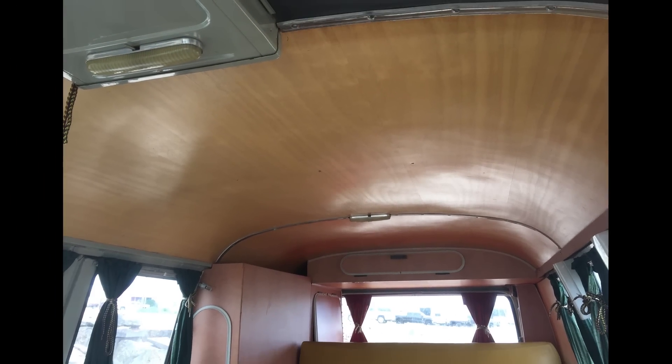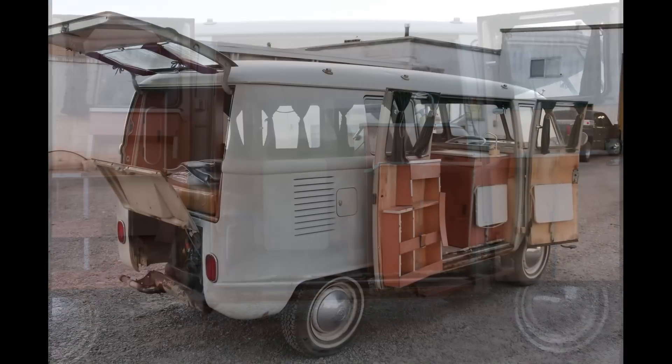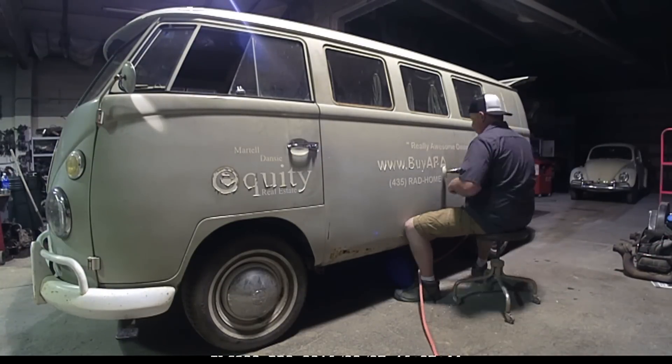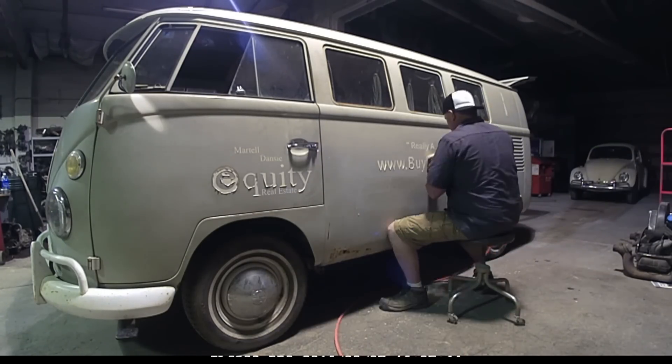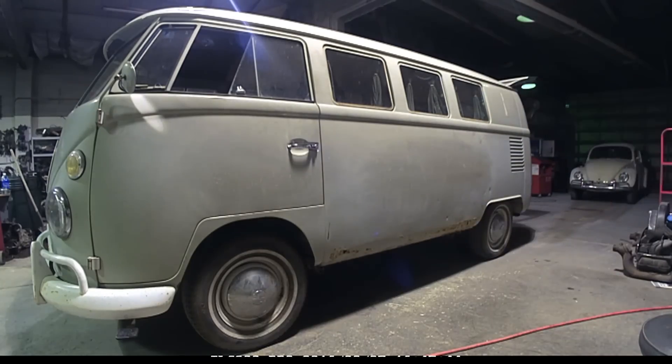The camper kit in the back was in great shape. The cargo doors were actually rusted shut, and that was a bit of a job getting those to open. The pins that lock the cargo doors into the rocker — one of those pins had just become rusted and stuck, so we had to soak it for a few days to get it open.